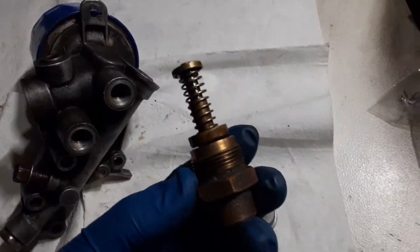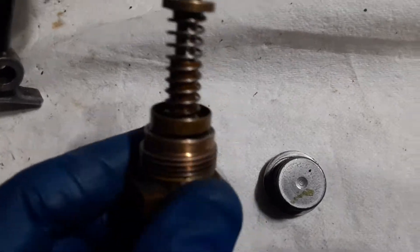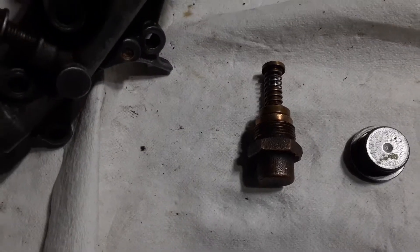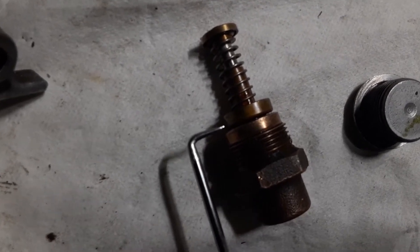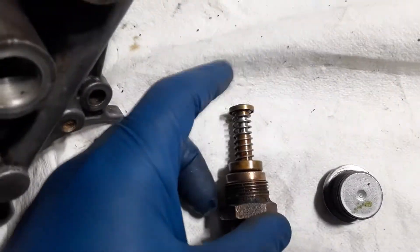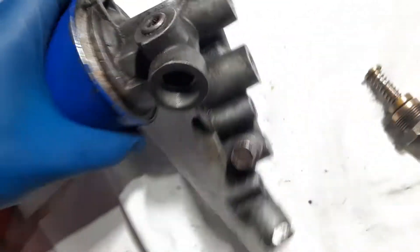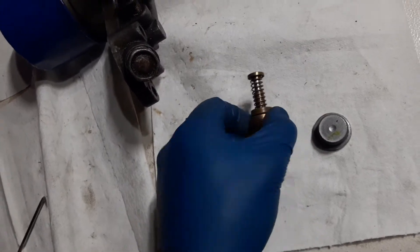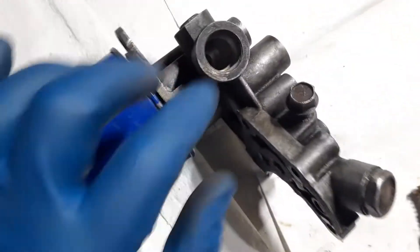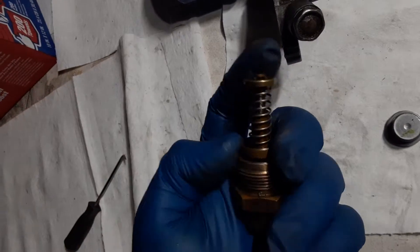So how that works is this thermostat. If you were to heat this up, this would extend from the seat here. This seat right here is going to raise this position right here up. And when that happens, the top of this piston is going to meet its seat in there. That happens when the oil reaches a certain temperature — I haven't actually checked what temperature these open at, but I have observed one of these opening in that manner. When they do, they lock into there, and what ends up happening is, because the oil can't bypass and go to a cooler, it has to fight the pressure of this spring to open.